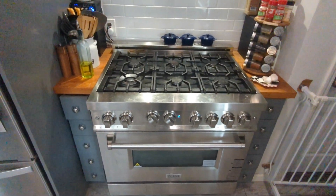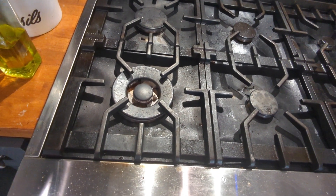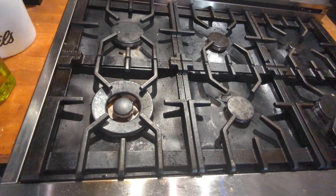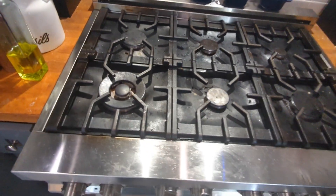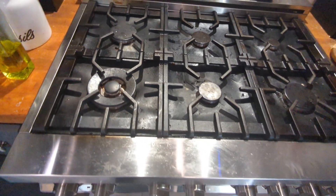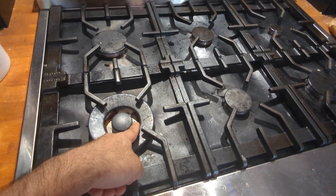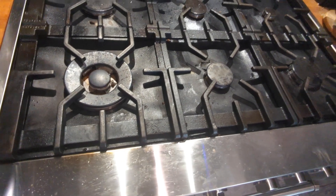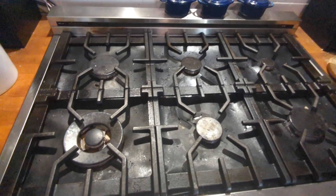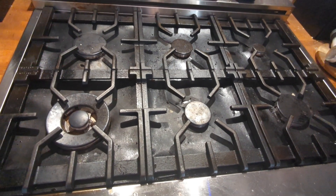One annoyance is that once in a while this big burner here — you can see it's not turning on. I'm not really sure why; I have to mess around with it. I have to bring an external igniter and put the flame there, and then it works just fine. But that is annoying. Once in a while it does turn on on its own. I have a feeling it has to do with this igniter piece here — that's the piece that arcs to the metal piece to turn everything on. But it just doesn't work consistently. When it does work, it behaves just like the first day.